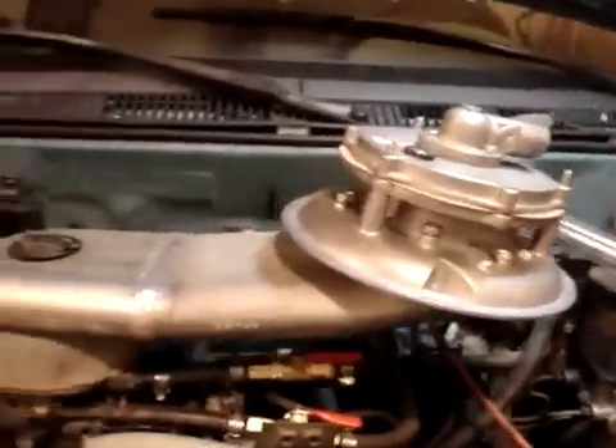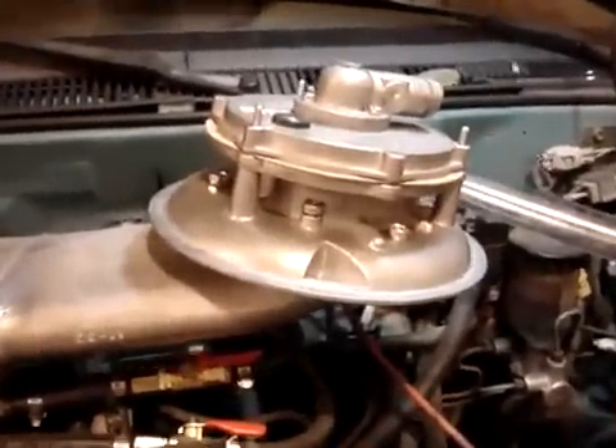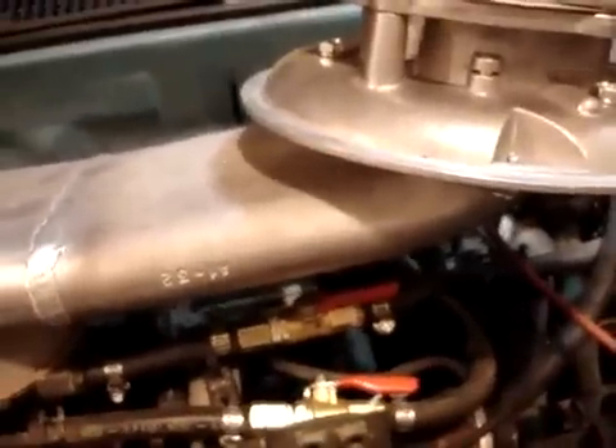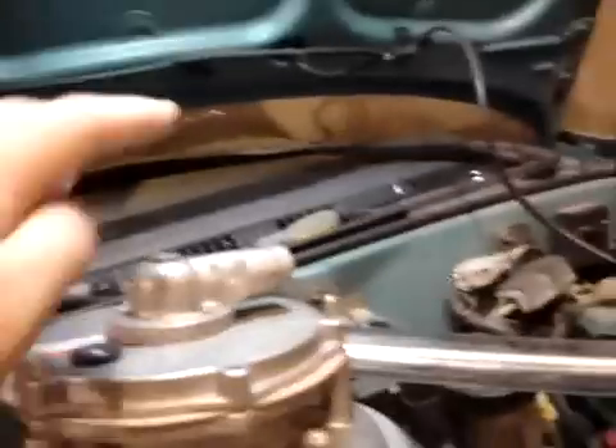You don't even have to change your timing or compress natural gas, and it works just fine. These are the shutoff valves for the gasoline — I shut them both off. And I have to close the air off so that I can get a vacuum on here so that I can actually pull hydrogen from my unit.